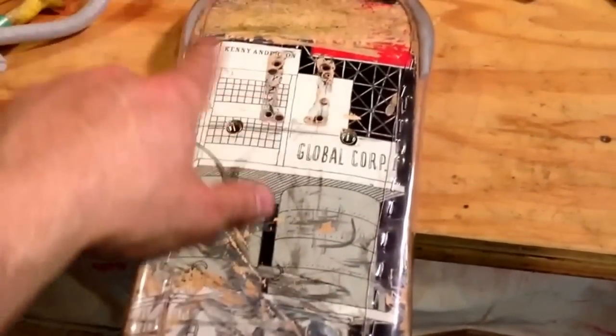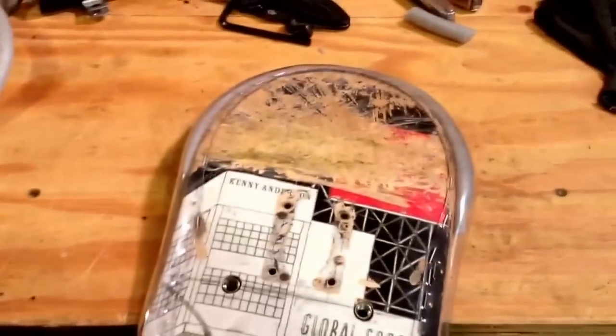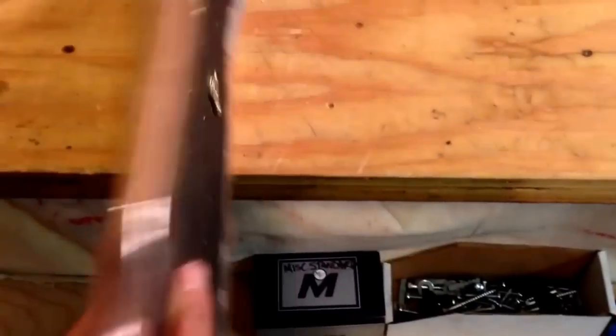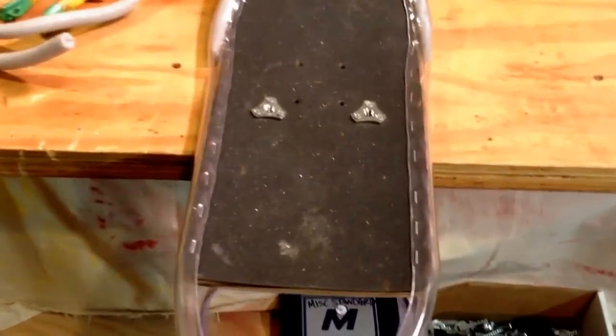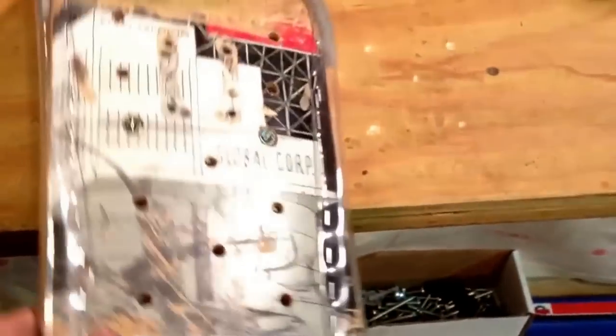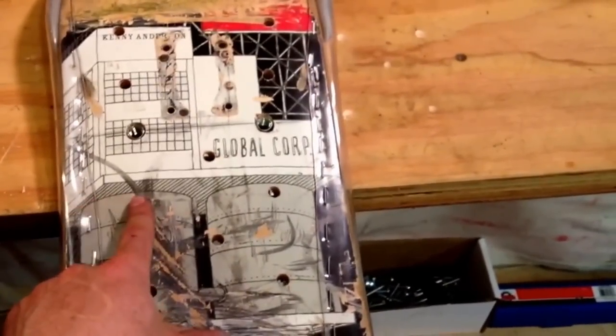The tube is running wild down here so I'm going to cut it off and throw a couple more staples in. Before I forget, I'm going to punch some holes with a drill bit in the bottom so that once it's upholstered it's not like a balloon that won't deflate when you sit on it — that would make it feel hard as a rock. Also, if any moisture gets in there you don't want it to live in there, so the holes allow any moisture to dry out.